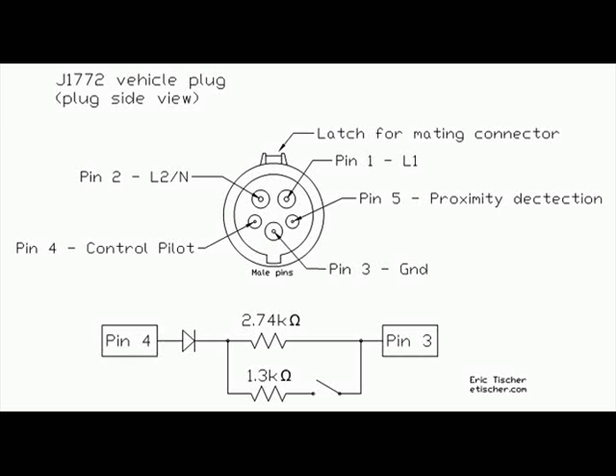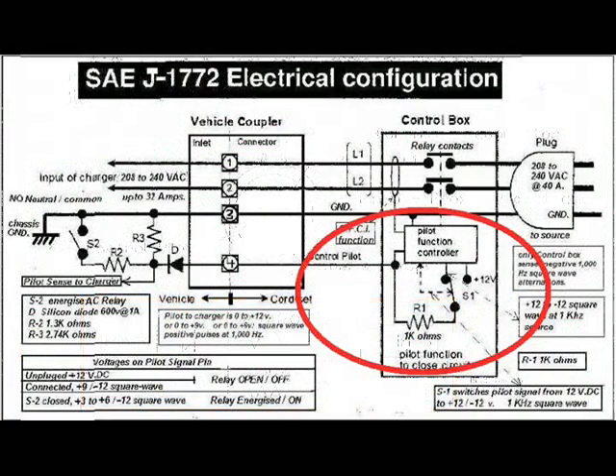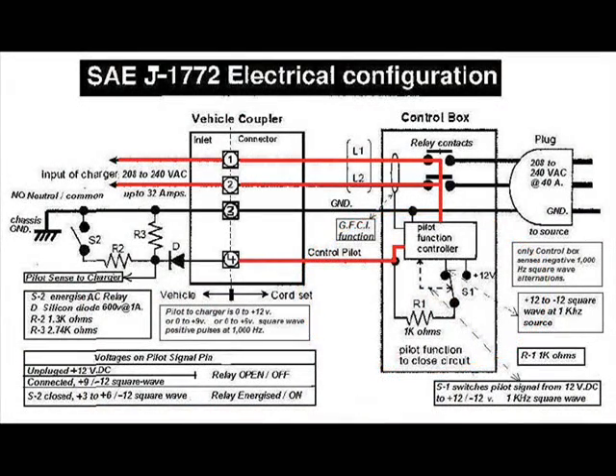During charging, a 30-amp 240-volt level 2 design relies on an intelligent last-in, first-out pilot pin loop at the junction of the J1772 connector and on-car inlet to signal a detrimental strain to the system. By the pilot pin pulling out, an interruption in the signal will break the loop, stop the charge cycle, and will safely de-energize the cable and connector. This is an effective fail-safe for strain in line with the connector.